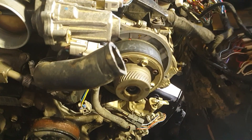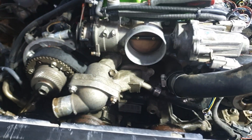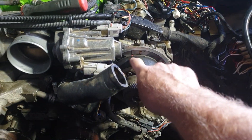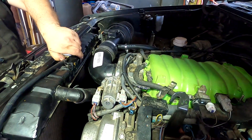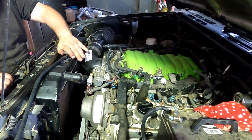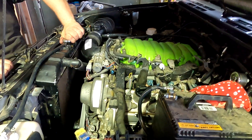No bottom-end power and then lots of top-end power, and then the check light came on. I hope I've said it enough: line it up with the line. If you put the belt on, do your two revolutions and line it up with the line — TDC at the bottom, line it up with the line. Hopefully that's been helpful. Definitely sounds better — funny how when you put the cam timing right it sounds better. Excellent, it's a wrap.